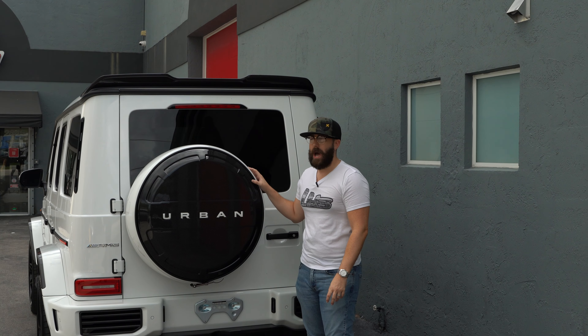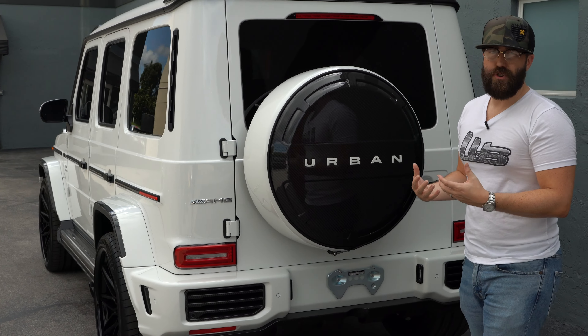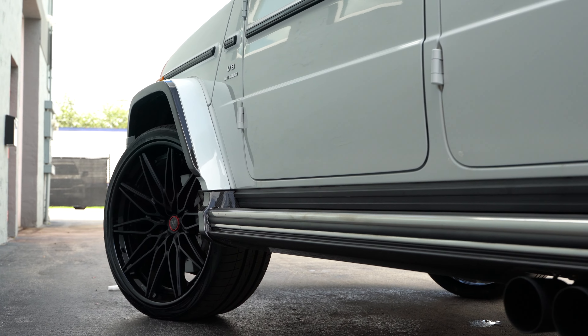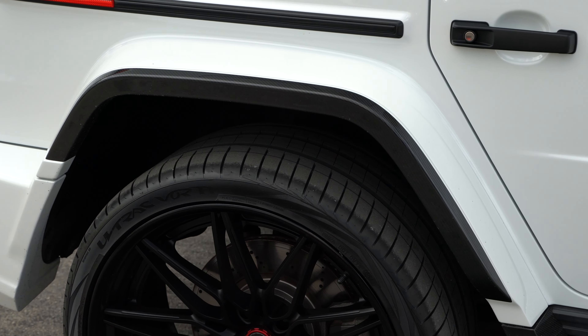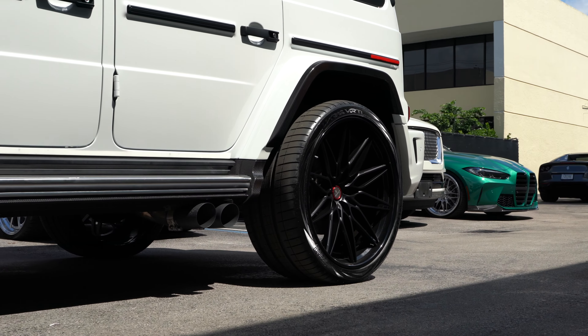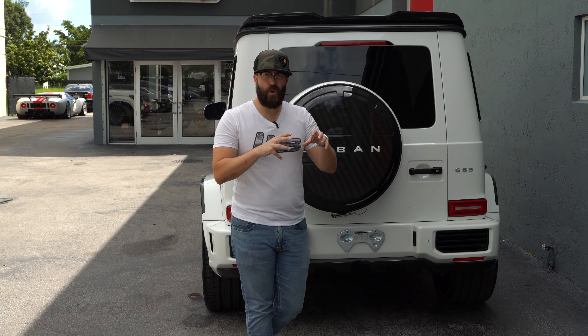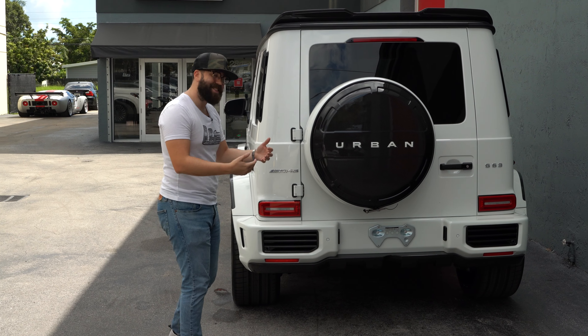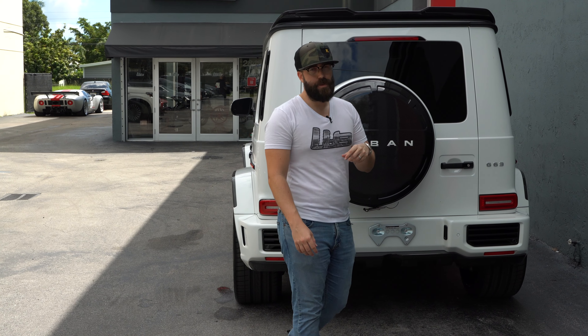From the wheel perspective, since we're widening the car a substantial amount it allows us to use a much wider rear tire. That tire is actually a 355 — 355 millimeters wide. Not every SUV can use that; the ones I can think of off the top of my head are wide-body G-Wagons, Lamborghini Urus, and some bigger cars like the Audi RSQ8. It has to be a full-size body SUV and in some cases needs a wide-body kit to fit these 355 tires. So it's 355 wide, 25 profile, and 24-inch diameter.